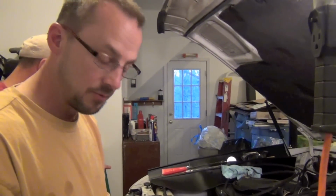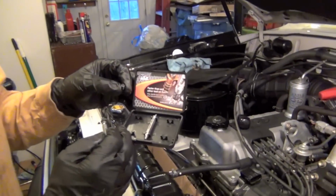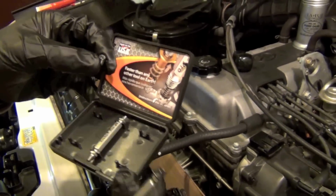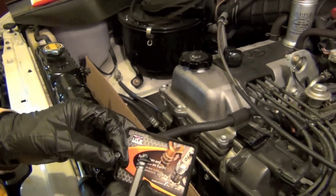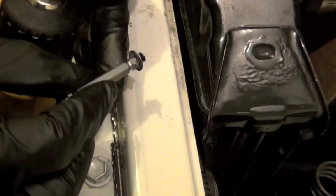The thing that really came through for us was these things called Grabbits. You can get these at Home Depot. This little kit of 3 has a number 1, a number 2, and a number 3 Phillips, which is what they're meant to work on. And I want to show you, if you can get right here against this white background, this one grabbed the head. This is where we were drilling around and trying to get that head loose. This one grabbed the head and broke it off because we had drilled down sort of into the shaft of the screw.